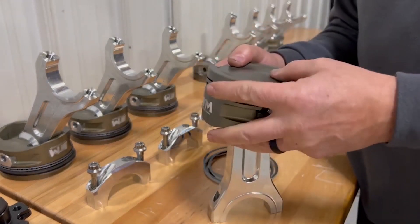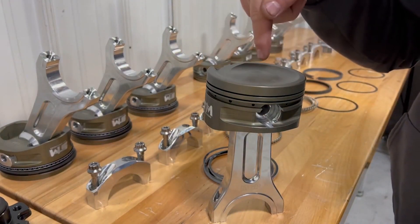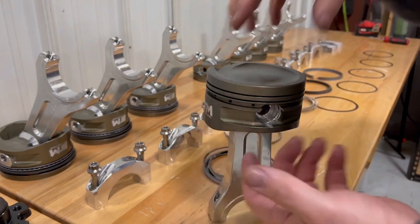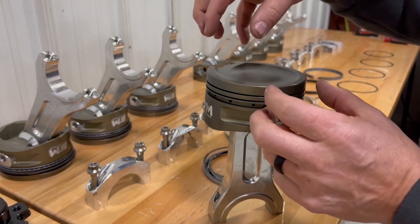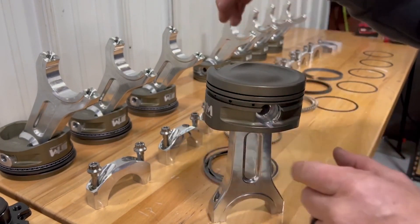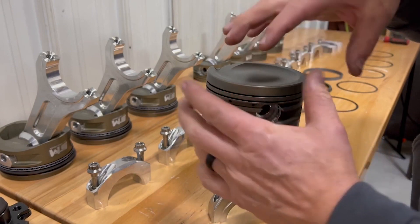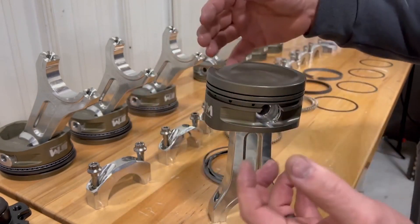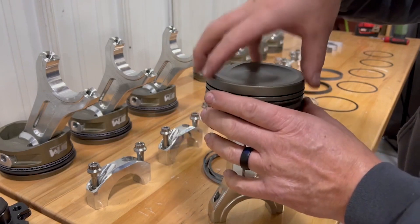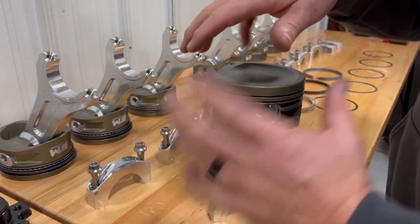An interesting note: rings rotate on the piston, and regardless of what you think, at some point they can't rotate at exactly the same RPM, so at some point in their lives they're always going to line up. I think the number is somewhere around 3 RPM - something similar to that. People put a lot of emphasis on indexing, and there really isn't much emphasis needed. I just do it because that's the way I've always done it.